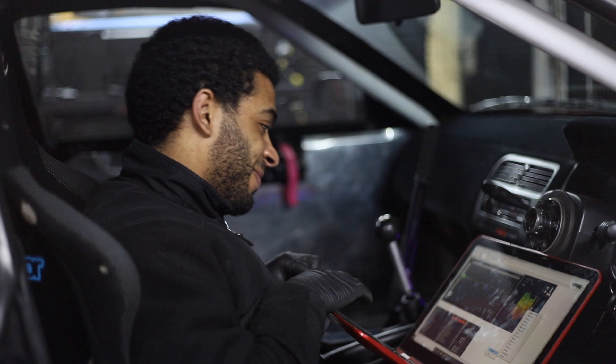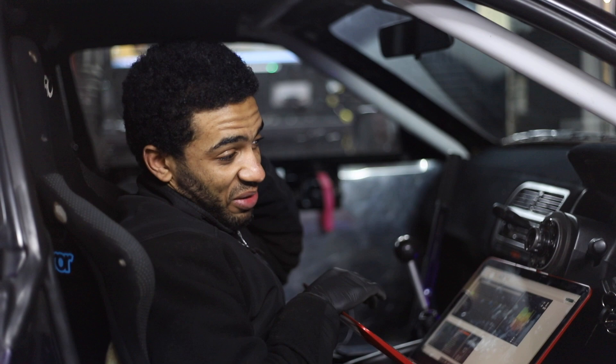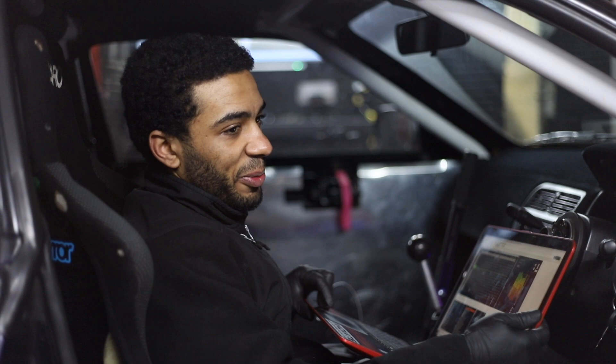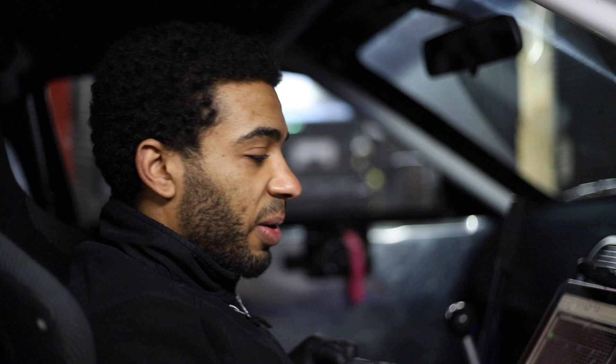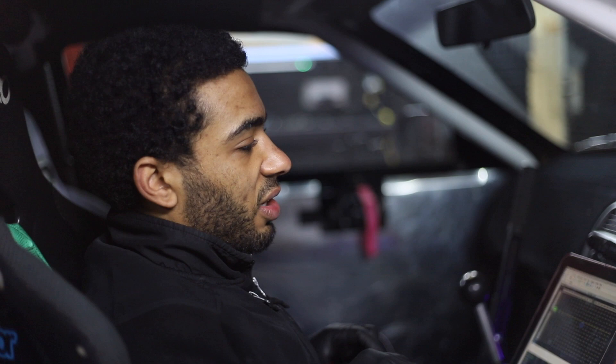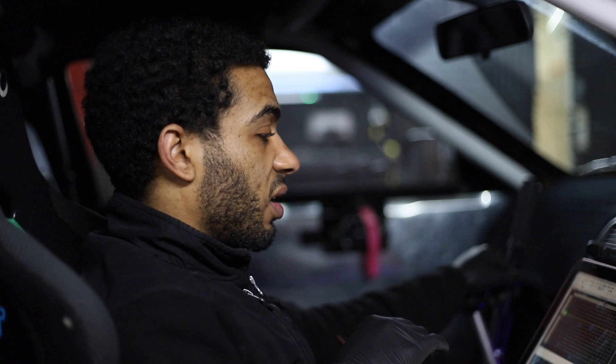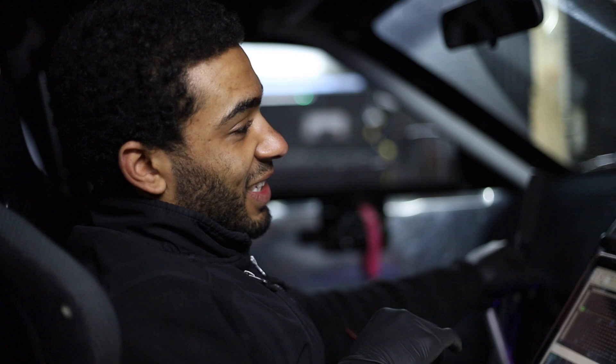Here we are joined by Dee from Motorsport Performance. What's happening? Tune in today? Yeah, RB25 Silvia S14 drift car — big single turbo, twin entry wastegate, full drift prep. Link G4 ECU standalone. It's been tuned by someone else before and the engine blew up — chucked a conrod out of the block and had a nice little inspection window in the block. The guy's rebuilt it and brought it to me to be set up properly on the dyno. Looking at the tune, I'm not surprised it blew up, so I'll get this dialled in this afternoon.